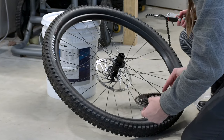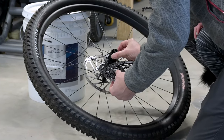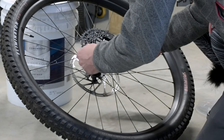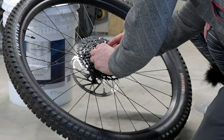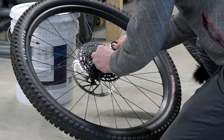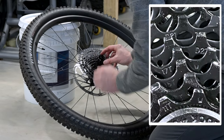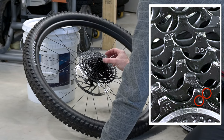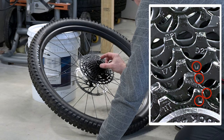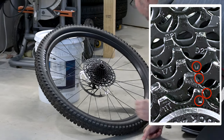With the SRAM NX 12-speed cassette, the largest four cogs are joined together by a spider. The rest of the cogs are loose and separated by spacers. When we reinstalled the cassette, I disturbed the cogs, so we had to fit them individually. With the exception of the smallest cog, there is only one way to fit them, as the free-hub body has a specific pattern of notches or splines that only allow the cogs to go on at a specific position. The smallest 11-tooth gear is more fiddly — we found no guidance on SRAM's website on how to install it, but pictures of the cassette show arrows on the cogs lining up in a specific way. We mirrored this approach. Please let us know in the comments if you have any better insight on the alignment of the final cog.